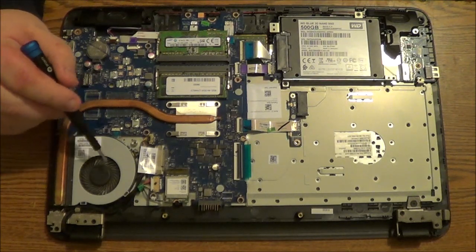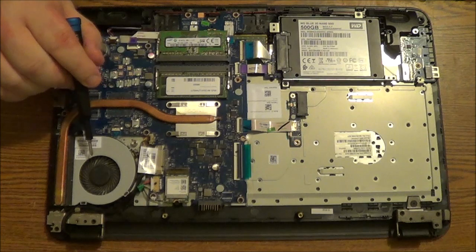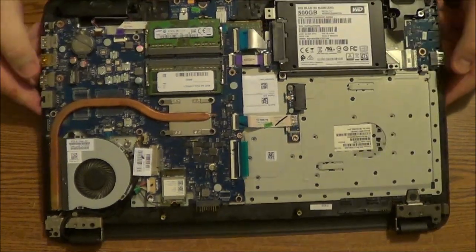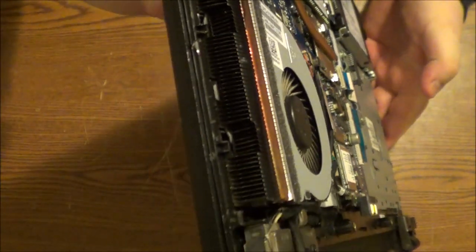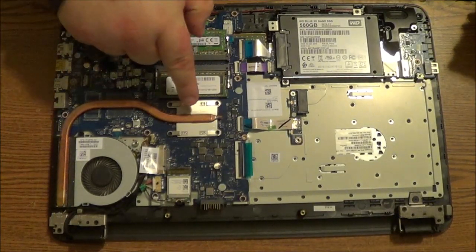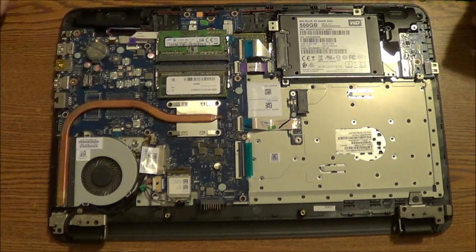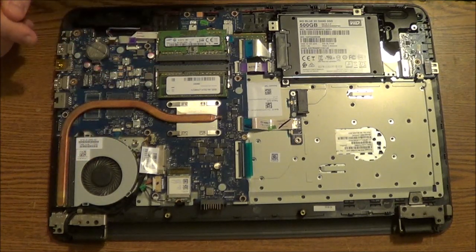Here you have the cooling fan. This right here is very important. You want to go ahead and clean that out. As you can see here, it's brown — that's from all the dust. You can also see the fins, how they can be a little dirty too. The more airflow that this can move, the more your computer can stay cooler. Right here is the main processor unit, and this right here has a little copper heat pipe that dissipates the heat to the fan. You want to make sure this air hole and the flow is very clear so it doesn't restrict any airflow.